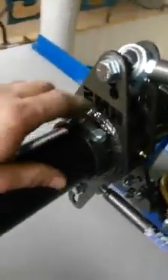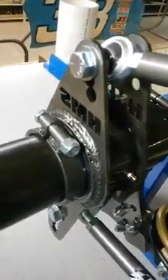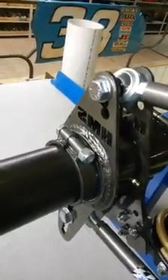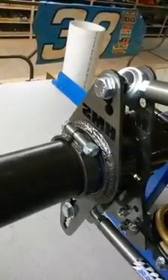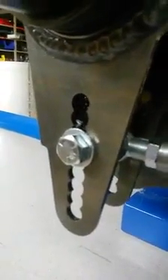On our cage here, just a simple design. The plate is all one piece for the upper and lower. We weld the whole cage together and machine the bearing surfaces afterwards — that way we know it's straight. I also fit every one over a tube to make sure the bearings are in squarely. All of our shock stuff is the 45 degree swivelers. And on the lowers, we can go from 3 3/8 all the way down to 6 1/2 inch drop on both left and right hand side. We've got a nice brace to incorporate the whole back side there.